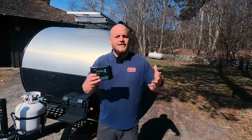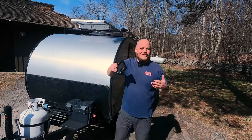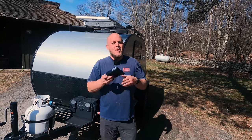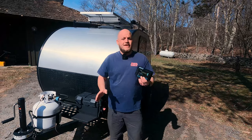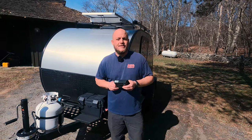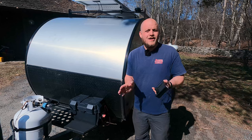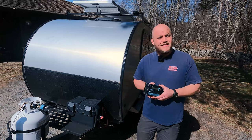Now that I have my charge controller selected, let's figure out where to install it. Some people actually screw it right to the panel and use it like those all-in-one kits — just run a wire down, connect it to your battery, and you're in business. You can't beat that for ease of installation, but I don't prefer it because I like to read the information on the charge controller — it tells you state of charge and how much current is going into the battery. With these waterproof controllers, some people attach it to the face of the camper near the battery. You can screw it in a watertight way or use VHB tape for a permanent installation. This is also a really easy way to install it.